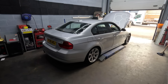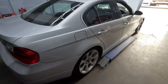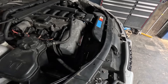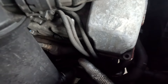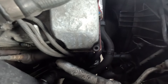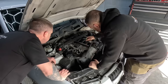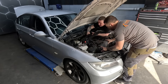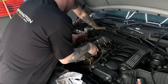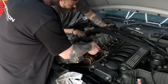We've left the car for a couple of days, but today we're back at it. Back on Jano's 330i E90 - today we're going to try and get the rocker cover done and get all them oil leaks sorted. It looks a mess. We notice there's two broken studs, which'll be a big cause of the leaks. To do this, we need to remove the Valvetronic servo motor, unbolt the rocker cover and lift it off so we can see inside the engine and see what's going on, where these leaks are coming from. And while we're there, we might get lucky and figure out why the Valvetronic servo motor is not actuating itself automatically.